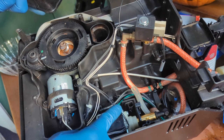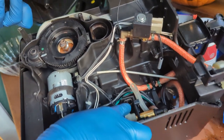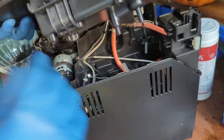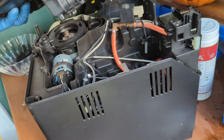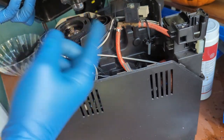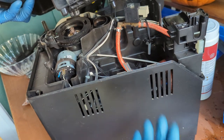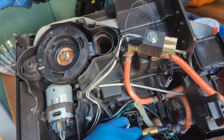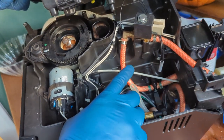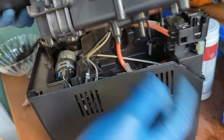just a reminder, that little hole over there, if this gets broken, what you can do is disconnect the hose at the bottom that is connected through there, extend the hose and connect it here, right here. It's going to function the exact same way, it is not going to leak. You will still have to secure the water pump maybe better, but it will not leak into the machine. It will leak straight into the tray. That's exactly what this does, just like a little bypass. So you'll be bypassing this. So if you end up breaking this for any reason, you can always bypass it by extending the hose underneath there and then connecting another one right here.